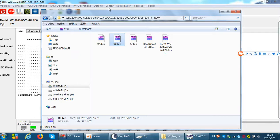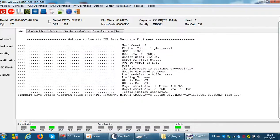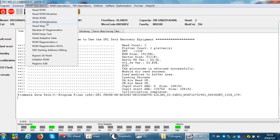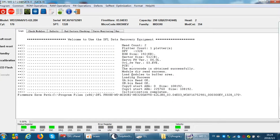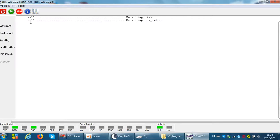We need to write this new module 0b to the drive so it will become valid with the new booting head 1. To do this, select module 0b and click Write. We can see write completes. At this time we need to power off and power on the drive again.